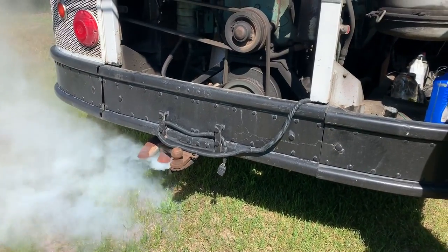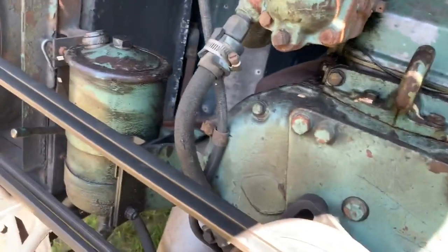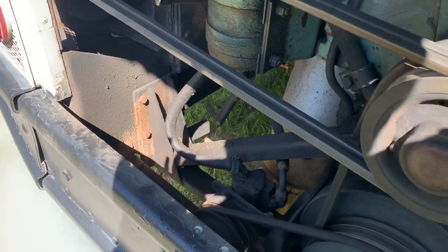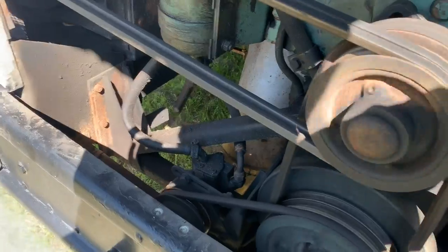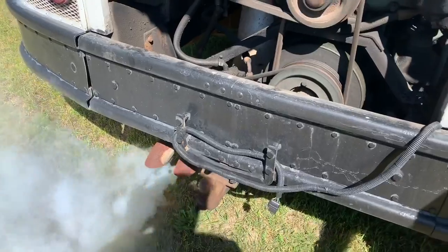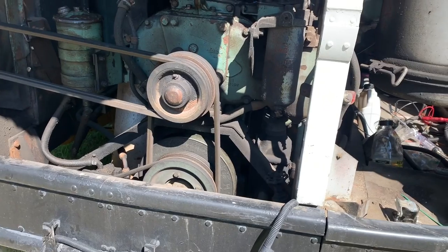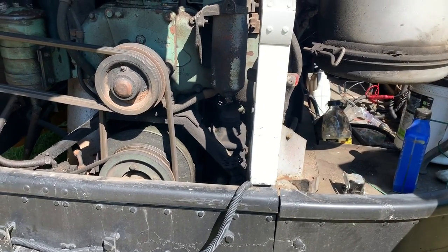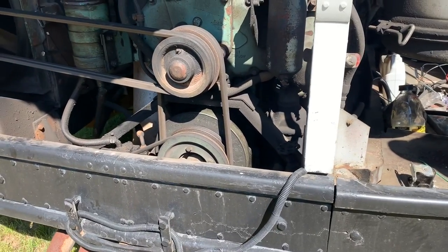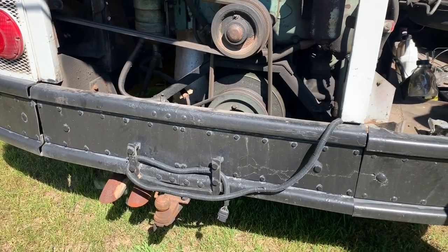That's good. So here's a trick, okay? If you come here and you hold this in the off position and go ahead and crank it, it didn't work. Normally, if you hold the fuel in the off position and you crank it over like that, the fuel is cold, spraying cold fuel in every cylinder. So now you can just turn it over where it's just building up heat from the cylinders moving up and down without introducing the cold fuel. Ah, gotcha. And usually that'll work, but that did not work. I never tried to start it cold from back here, but I can't imagine that being any different. Yeah.